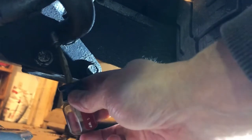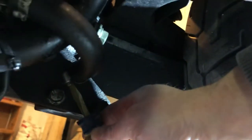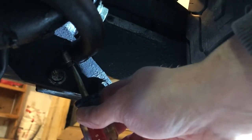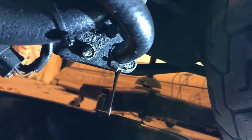I'm just using a standard screwdriver to take the hose clamp off, loosen it up, and then you should be able to slide the hose off. But before it comes completely off, make sure you put your drain pan underneath to catch the oil. Now that the hose clamp is loose, go ahead and pull the hose off and let the oil drain out. It takes about 15 minutes for all the oil to come out.